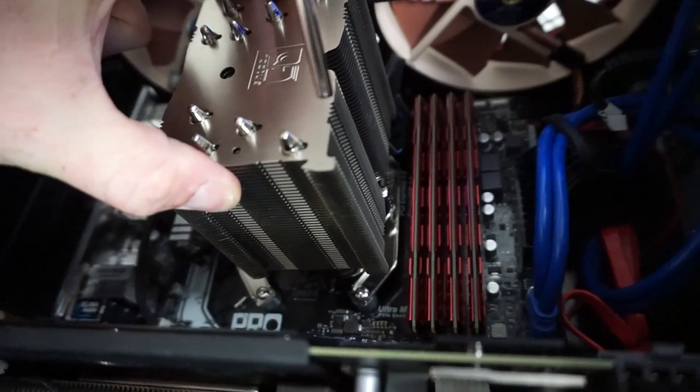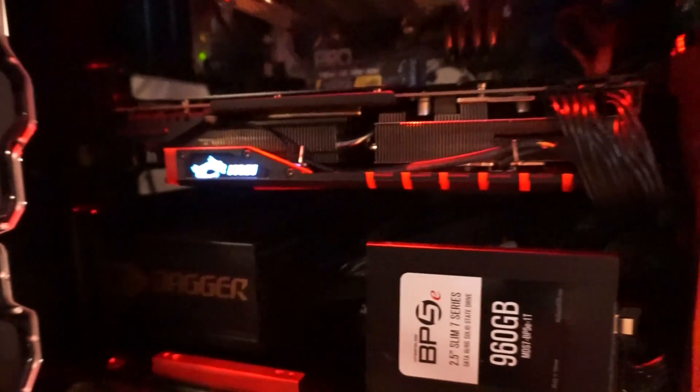I know that my Ryzen system is at max temperature — I've done several videos about this trying to get good temperatures. To make matters worse, I've got these lights in here and it's warm out. I'm in the basement so it's still pretty cool compared to upstairs, but temperatures have been rising since summer started — so this is at an all-time high. Plus I just got rid of my RX 480 blower-style card, which was really nice to have in this system, and I've been using an R9 390X — probably one of the hottest cards I've ever had. It's as big as the case, so there's very little airflow to the graphics card. I have to have the fans at 40% minimum to get any cooling, and that's going to hurt my CPU temperature.